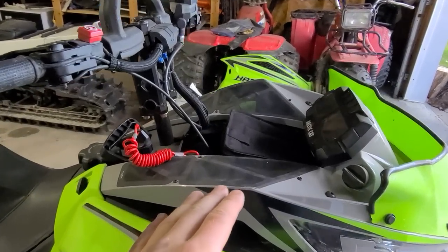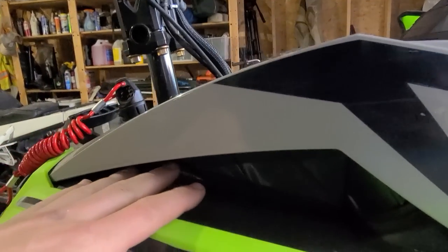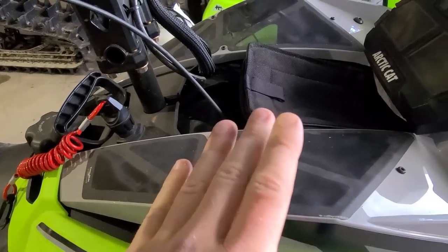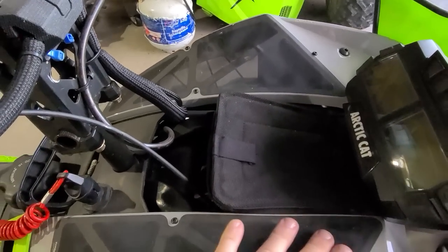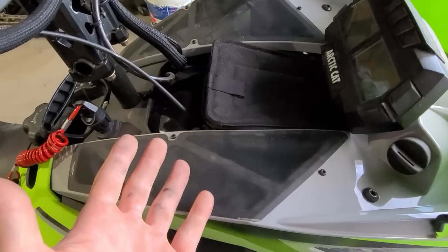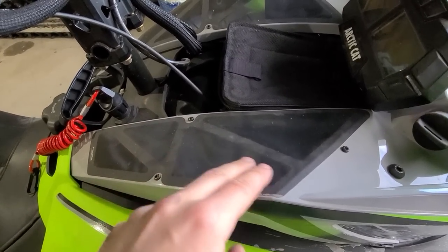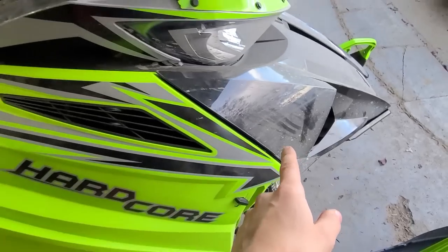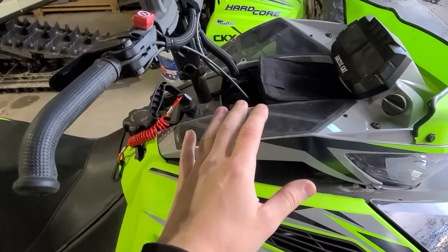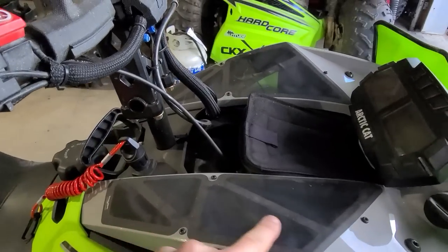While checking the body on these Cats and most units, the air intake is up top, and there's also a frog skin on the bottom — this material here that lets air in but not moisture. You want to make sure there are no holes in these frog skins. If there's a big hole, you could be looking at a motor that's either cratered or about to crater. I've seen these ripped and destroy engines due to snow ingestion, especially on a mountain sled. Make sure the intake vents are fully intact.